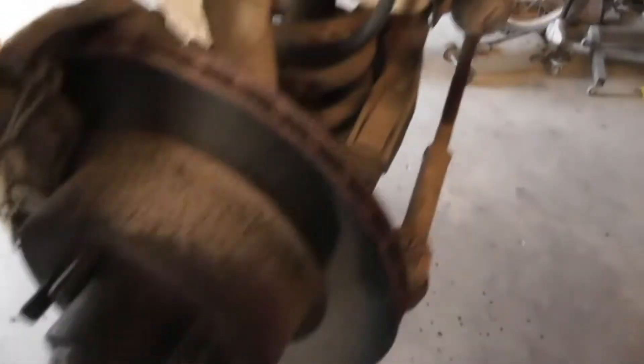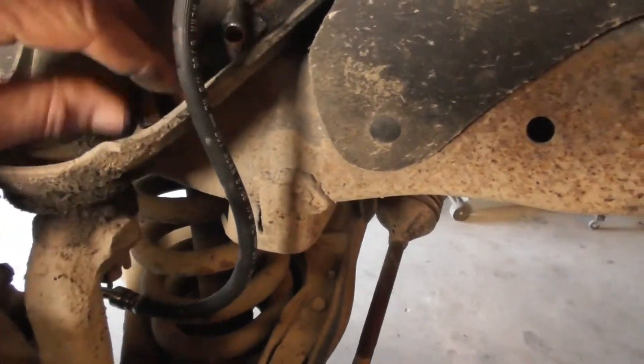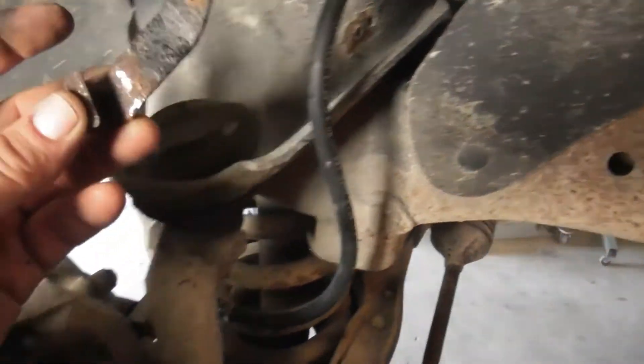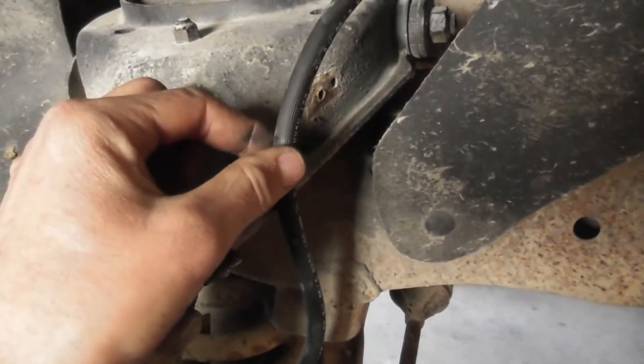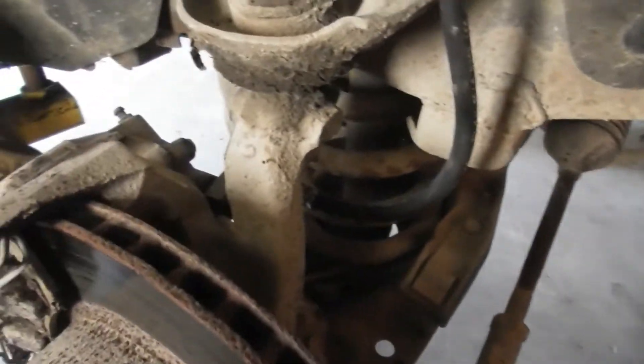They have these clamps on them — now they're clamped around the hose, bolted onto the A-arm. Well, that's fine when it's new, but after it gets old and rust gets in there, it builds up and starts slowly squeezing the hose, blocking the flow of fluid to the caliper.